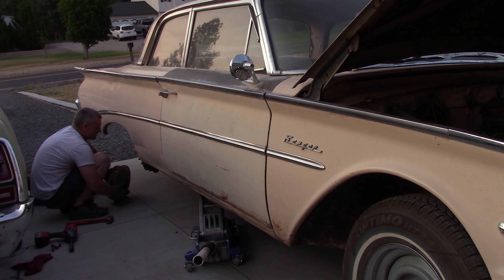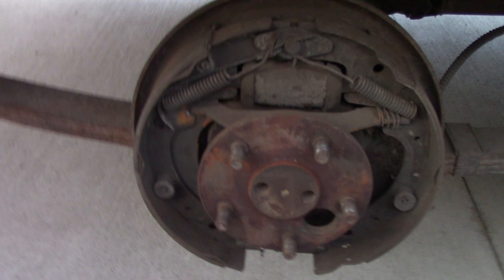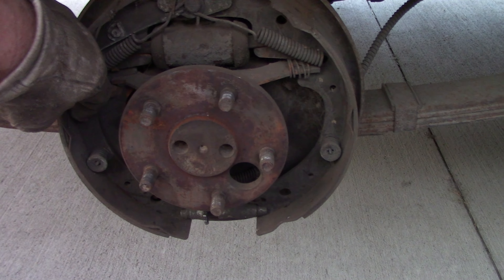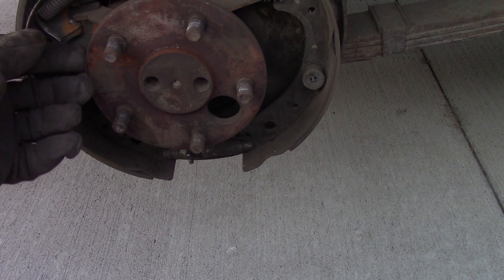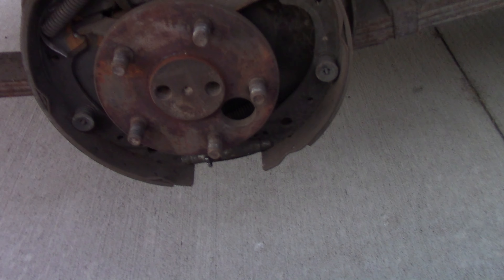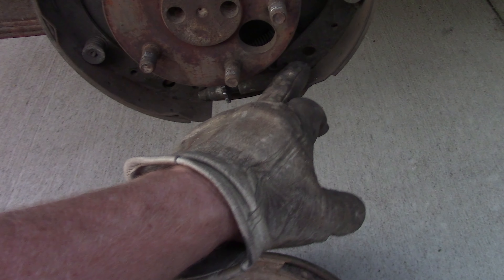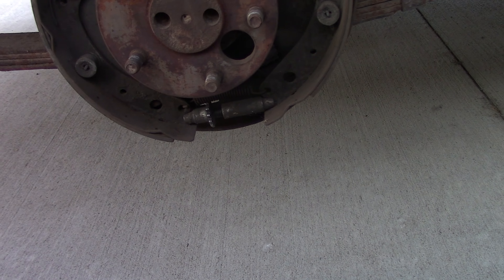Here, I'll get the camera in here and show you. On the right rear, you can see it has the self-adjuster cable — comes down — but the cable is just frayed and broken right there. You can still get these kits; it's not a problem. But the other part that this hooks to, and the spring that goes on the bottom — that is all gone. We'll see what it looks like when we get to the other side.